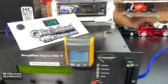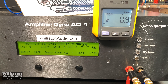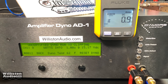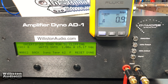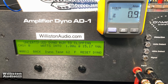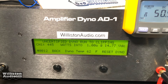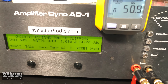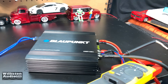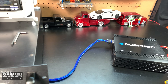Let's try the one-ohm uncertified test for this fake Blaupunkt at 40 hertz. If we see any sparks, this will probably be the test where we see it, because the uncertified test is brutal. Either it's going to pop the fuses, go into protect, or something like that. Here we go — 445 watts at 14.77 volts. You can see it pulled right at 50 amps of current and then popped the fuse. We'll have to replace the fuses and try 0.5 ohms.